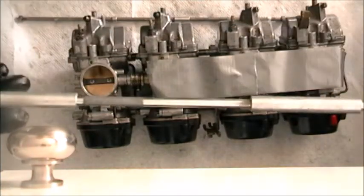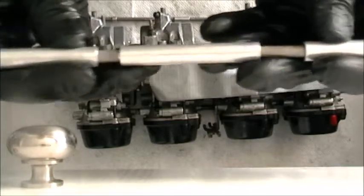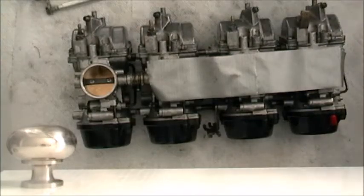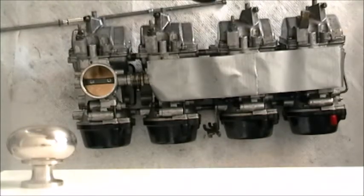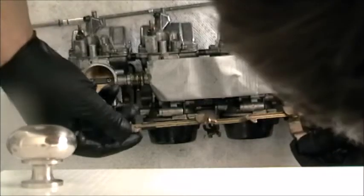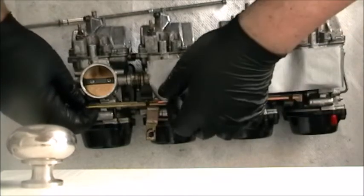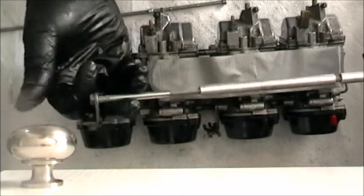Basically, you've got two bolts that go all the way through the carbs, and they have these separators. There's a set of aluminum ones where there's a long and two shorts, long going in the middle, and there is this other bolt that's got a set. There's two really shorts and one long, and they're the opposite bolt. So through these carbs, if we're looking, the one set is up here, and that's going to be my longy shorty. And I believe that the way the choke mechanism works is, oh no, I think it goes this way. Let's just verify. So if the choke goes this way, which it definitely does, then that means that this long bar goes with this at the end that is the number one carb.